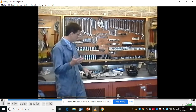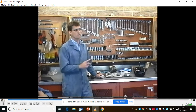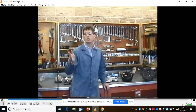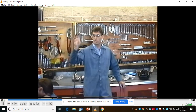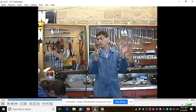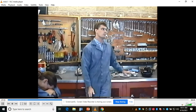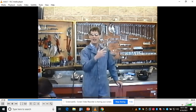Well, let me just say this, it's a bolt-up situation with one exception. The spindles on a drum brake car are different than a disc brake car. If you have Jason's Chevelle, when you buy the $250 kit from the junkyard, you can get the spindles as well. They come with the disc brake car, and it's a bolt-up situation in your car. On my car, it's not, because the lower ball joint size is different than this one. You say, how did you know that?